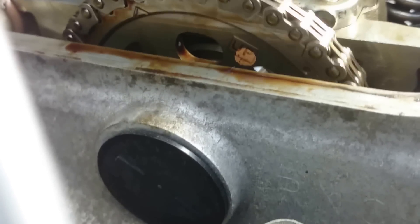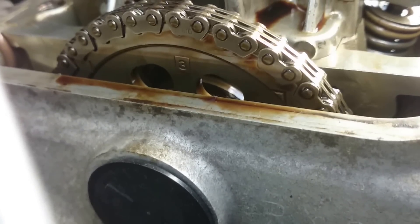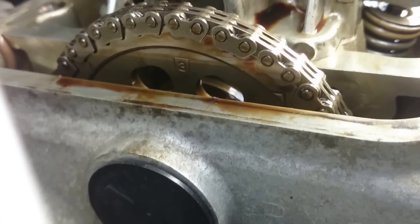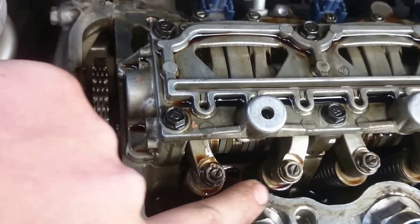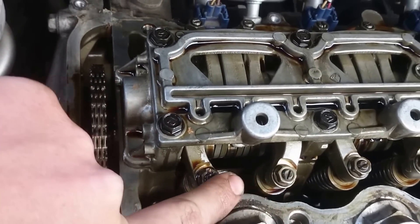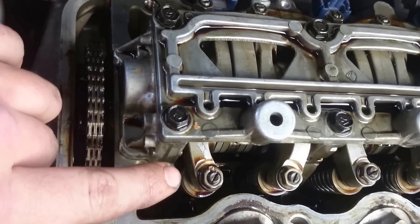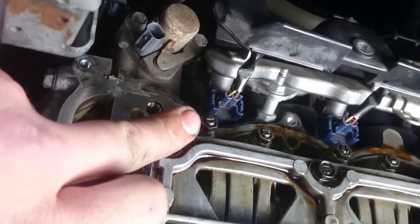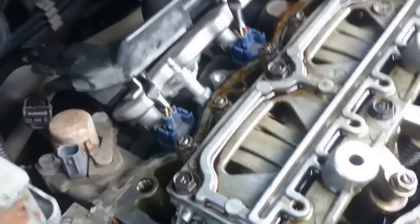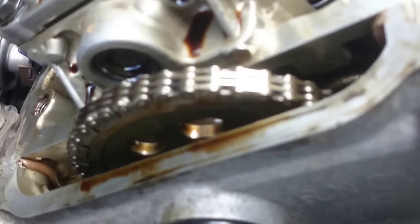When you turn it again — there's a nice bit of compression — you'll see it will line up on number 3. The valve lash clearances for exhaust, which are the front valves at the front of the block, for piston 1 — there are 4 valves per cylinder. The 2 at the front are exhaust and the 2 at the back are intake. Exhaust need to be set at 0.25mm and intake at 0.20mm. I'm doing this video because I found it quite difficult to find any information on doing it yourself.